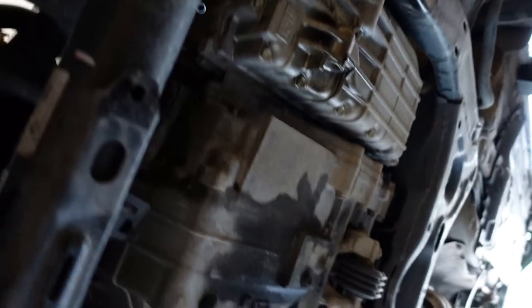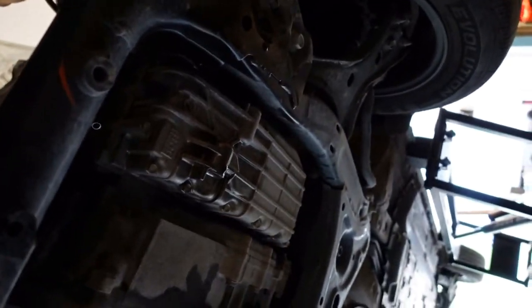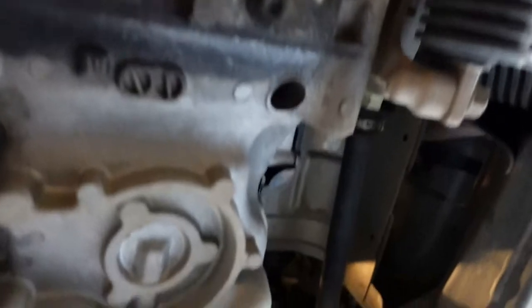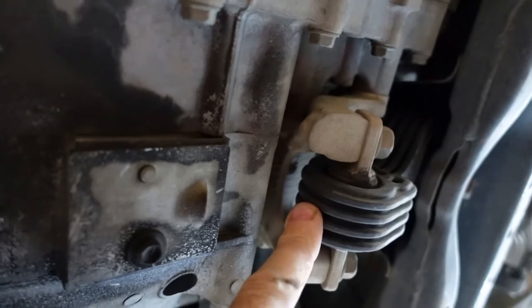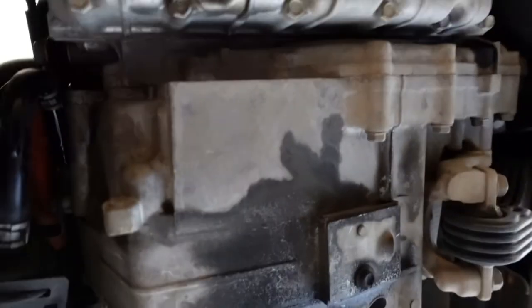So, basically, what's next, after I put the plug back in up here, is I have to pop the wheels off, separate the steering knuckle and the lower ball joints, right there and back there, and then take this mount off. And it says I need to disconnect the steering, but I have to see if the steering is attached to this crossmember. Because this whole crossmember has to come down before it then comes out.